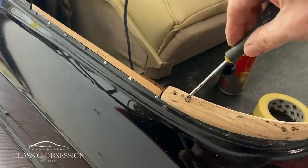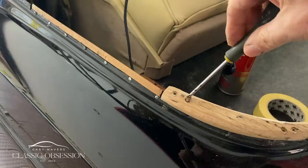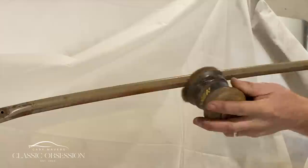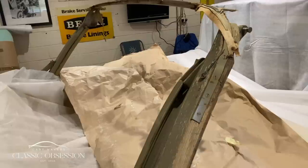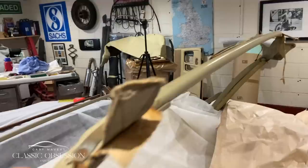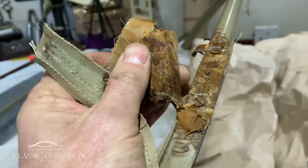I then move on to the hood at the rear that was rotted, and made up from bits of hardwood I have sitting around. I shape it carefully and fit it, so the rear of the soft top has something to staple into. I then set about cleaning the metal bows of the frame itself, and on closer inspection I see where leather or canvas torsion straps have been previously fitted to evenly separate the bows, and also support the canvas or vinyl soft top that once lay above.